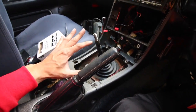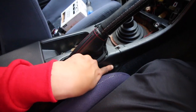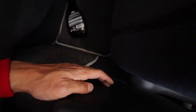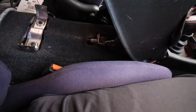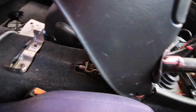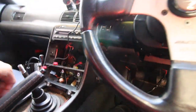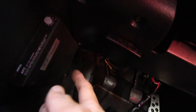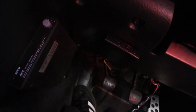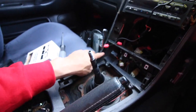I got this all taken apart. To get to the E-brake, right here there's going to be four screws — one on this side, one on this side, and on the same opposite sides here — because we just want to get to that wire down there for the E-brake handle. Now it looks like there's already a spliced wire. This wire right here is somebody already spliced, and I'm guessing for either the AFC — I have an Apexi AFC — or I have no clue what this other thing is. But it looks like it already has a wire going to the E-brake signal, so I'm just going to tap this with one of these tappers.